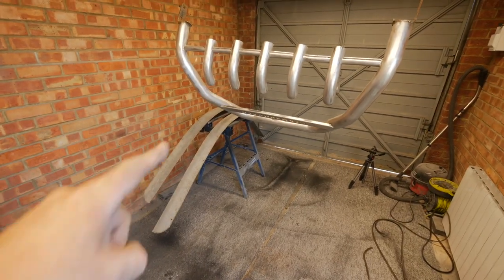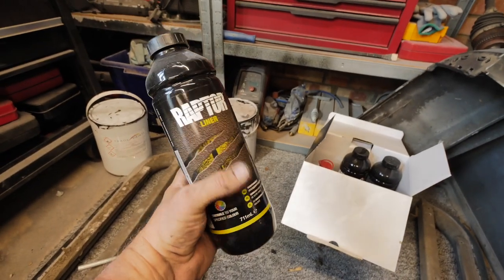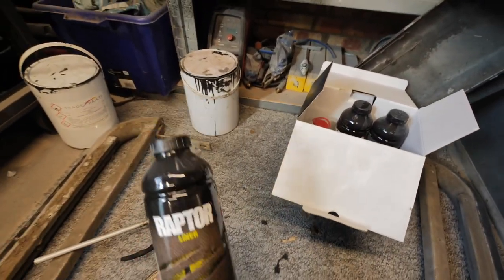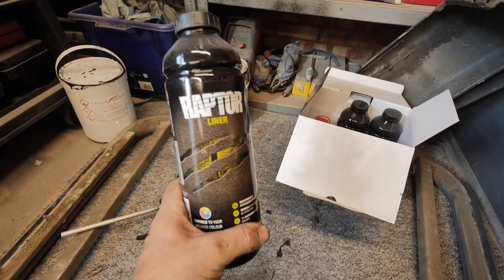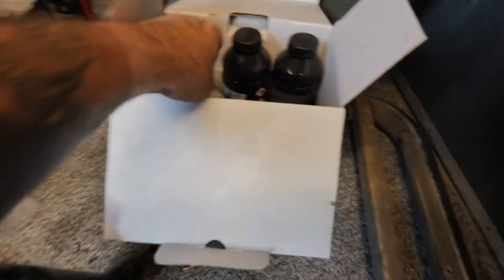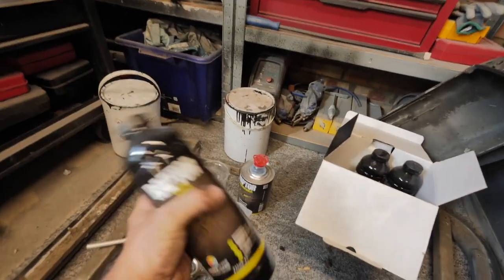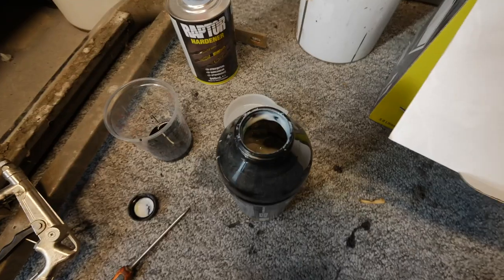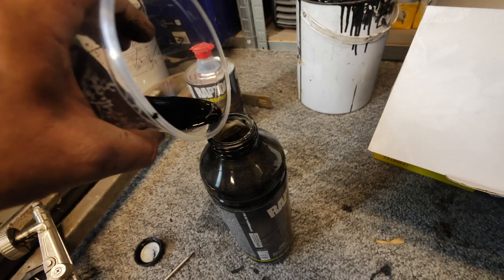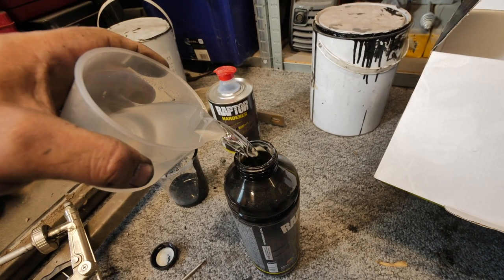That's everything ready for spraying. Same as last time, I've got the gun set up to 60 PSI. The Raptor is a creamy colour inside because it's the tintable one — I want black. I meant to buy the black but didn't, so I've got some black here. You add five to ten percent of your colour, so I'm going to add five percent of this black because black colours it really well. Then you've got the hardener — you've got a little mixing cup with a fill line. Fill that up with hardener, give it a good shake, and put it on the gun. You can see inside it's like a creamy colour, so I've got 50ml of black — add that in, hardener to the fill line, add that in, give it a good shake.